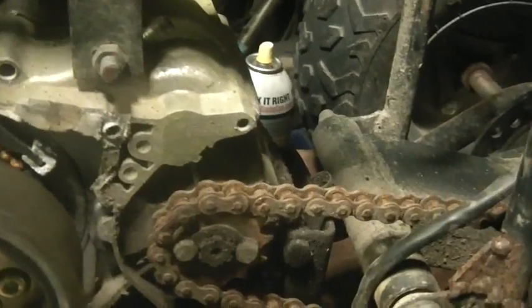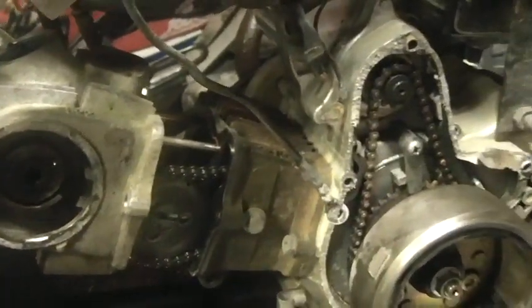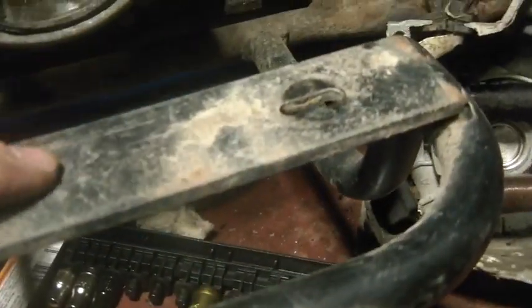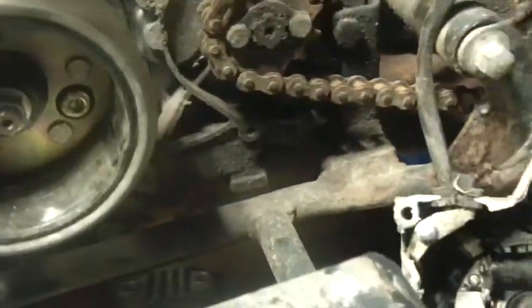Just quickly working on these things — really more or less a piece of cake. You've got two bolts here, two bolts here, two on the other side, then there's a couple up front, and the plastic comes right off. Don't forget to unplug your wires and don't forget to take off your gas cap. So plastics are off.